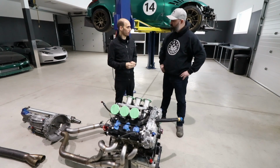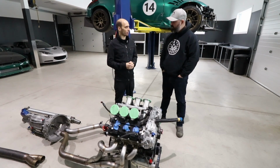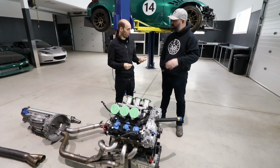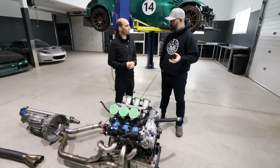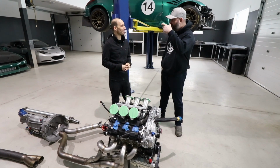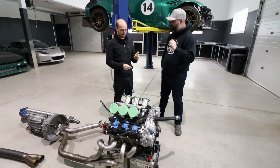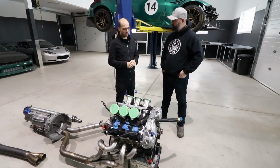The JE pistons are really cool. They only have 2 rings. One of the main areas we wanted to work on with this engine was friction. So 2 rings, from 3 typically. Exactly. That's just reducing your frictional losses. You obviously still have an oil ring and a top ring, and you've ejected the middle ring. Yep. You have a shorter skirt on the piston, and you've taken a bunch of weight out of the piston as a result. The piston's super lightweight.